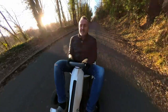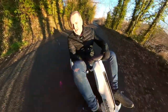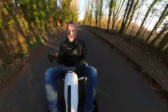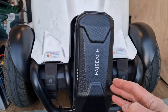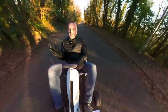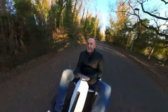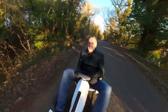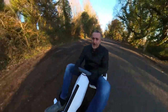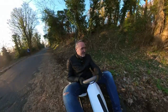It's quite simple to do because the Segway itself is what powers this car. Effectively I've got a 5 amp-hour 15S LiPo tagged on to the actual main battery of the Segway, and that has doubled the capacity and doubled the run time. The existing 18650 battery is good, but it doesn't hold up well to 20 amps of current rushing out of it.